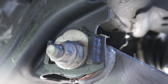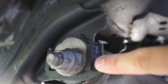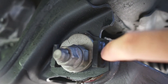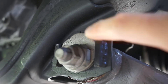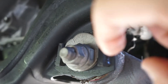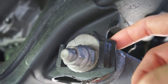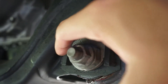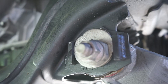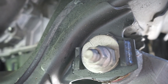To wrap up the last part of these eccentrics, I just wanted to show these cam tab gussets welded up to the frame itself. I already have them painted and installed. You would just go through, have these eccentrics go through, line up, tack them in place, and then weld them on the back side for these back ones. You can weld over here too — you can see I have a small bead there. Stay tuned — we'll get all of this suspension bolted up and see the final product in this long travel install.